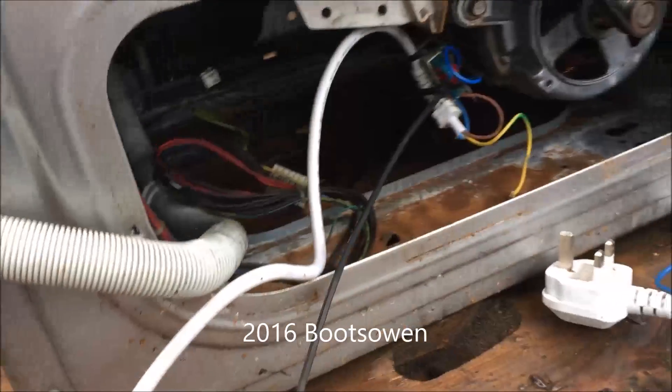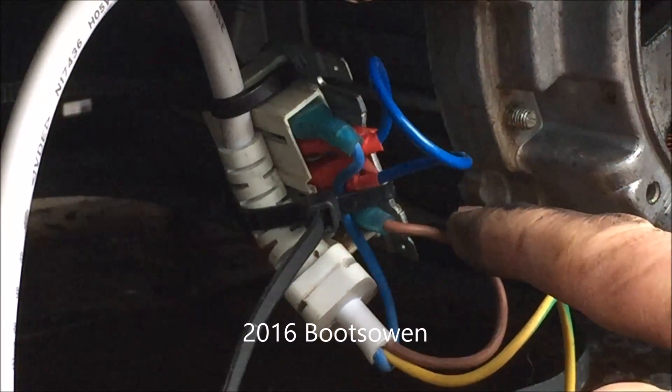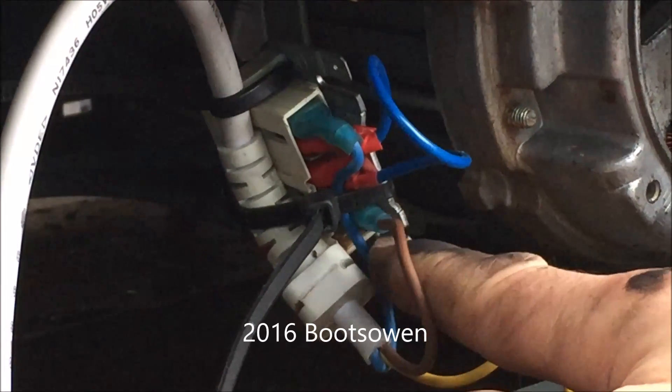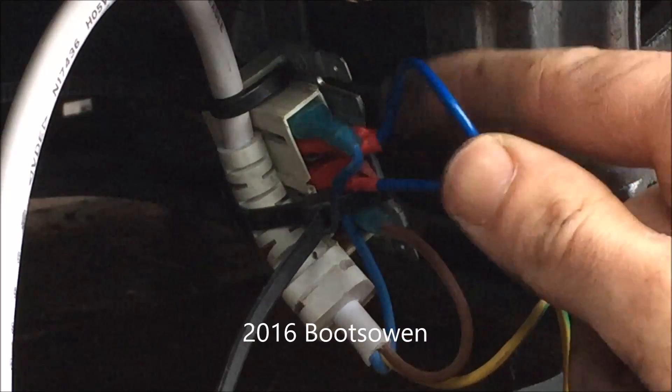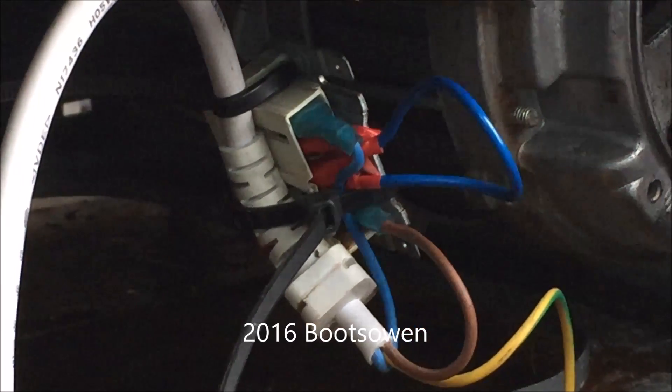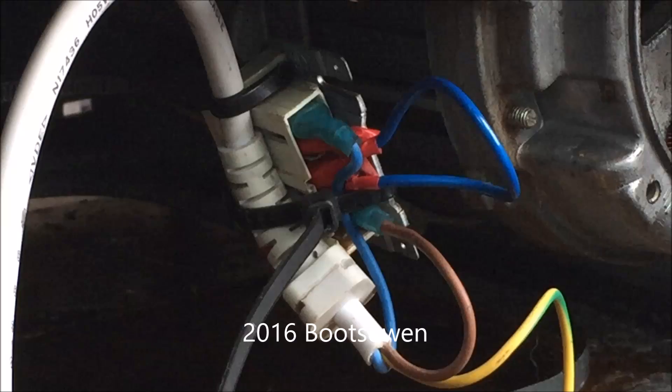So that's it, it's wired to go. Let's have a quick look at how I've done that again. So this is how I've wired this Hotpoint WML540. I've got the live going into the third tab from the bottom. Then I've got a jumper cable coming from the tab above that to the second from the top. And I've got the neutral at the second to the top. That will wire it to run in what some people call suicide mode — others just call it direct wiring. What I also typically do at this point is strip out any other parts I don't want to leave in the machine, but I don't really care about this machine. So what I might just do is put a bit of wire around the springs in the top so that they don't jump off in use.